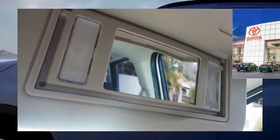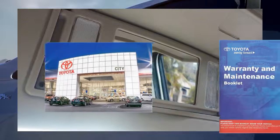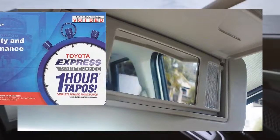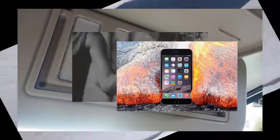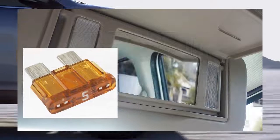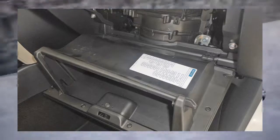If you have this issue, the protocol is to go to your dealership and have it replaced without worry, because this is covered by warranty. But before that, you need to kill the lights, otherwise you might drain your battery or melt some parts of the mirror assembly. There are two ways to turn it off. The first one is via detaching a fuse, and the other is via opening and tweaking a component in the mirror assembly.